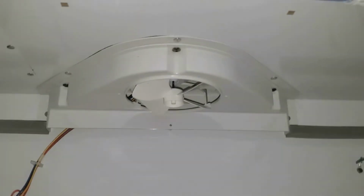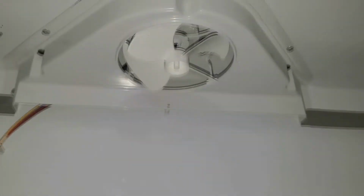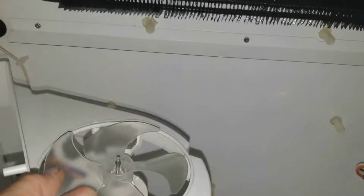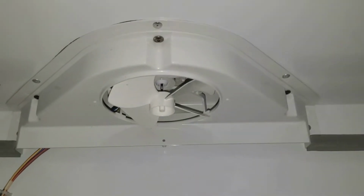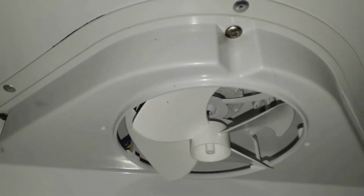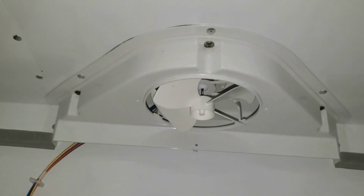You know, at Sub-Zero, the color of the fan blade, believe it or not, is a good indicator as far as upgrades and revisions. You don't want to just think you're going to put that harness on this fan and leave it in there because it worked. So get that out of your head, that if the fan worked, you can leave it and keep this for truck stock, because it's a different configuration. The fan blade is different than this one. It's part of the airflow upgrade, and it needs to be changed.